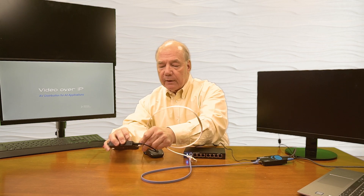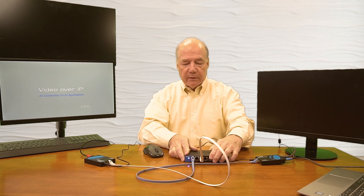There's one more feature that I think is amazing. Right now this is a one-to-one relationship — one primary location and one secondary location. But if I'd like to distribute the same content to multiple remote locations, this product allows you to cascade additional receivers off that single transmitter. To do that, you'll need to use a one-gigabit switch, because you're pushing a lot of content through it. You connect the transmitter up to the switch and then connect multiple receivers up to the same switch — all of them can be up to 150 meters away. I'll disconnect the cable from the receiver, plug that into any port on the switch, and then reconnect this with another cable to the switch by plugging it into the LAN port on the receiver.